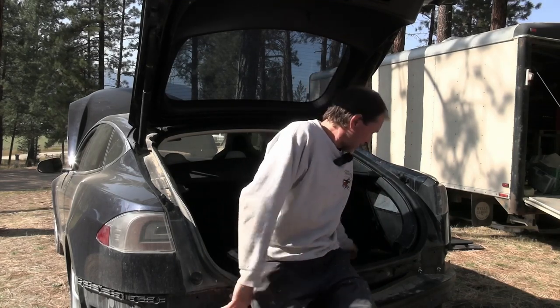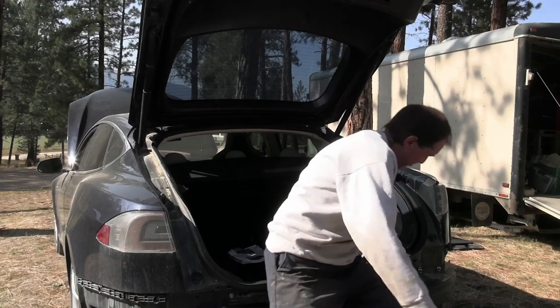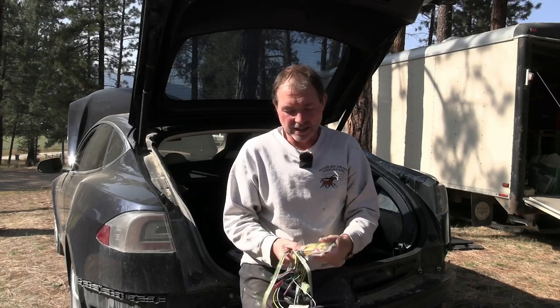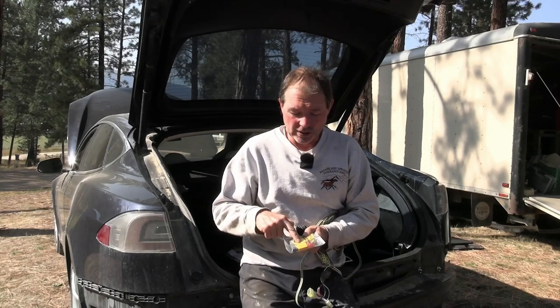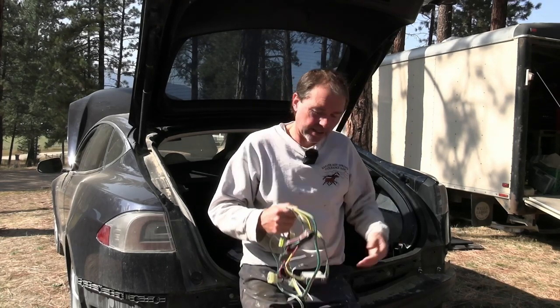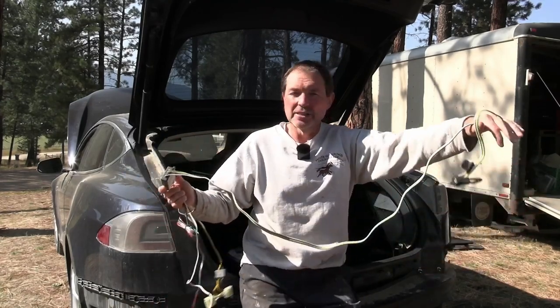So now that said, what are we going to do? Since I'm really cheap, I happen to find a T1 connector for a different vehicle. And that actually comes as a kit. The kit includes the wire that runs to the battery of the car. It's got an inline fuse holder with the fuse. This is a 10 amp fuse, and that's what you run from the battery or from a good power source to this box here. And this will then power these lights here.